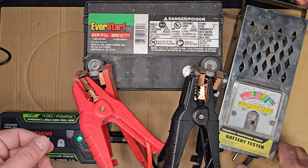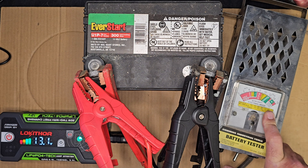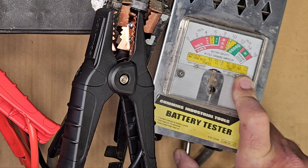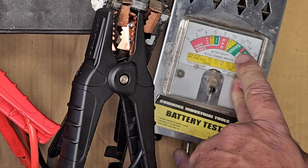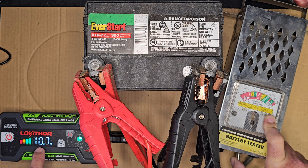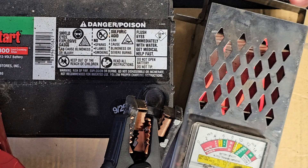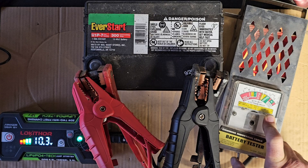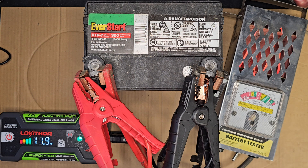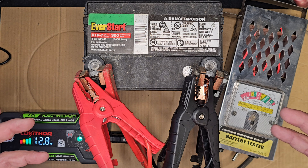It's in force boost mode and we'll boost it this way. Now it's like hooking a battery direct — no reverse protection or anything. Let's hold this button and give it a 200 amp load and see how long it holds it. We're holding it at almost 10 volts — now 10.7 volts. Holding it, holding it. I could probably shut this light off and you can see that's glowing red. She's smoking pretty good now.